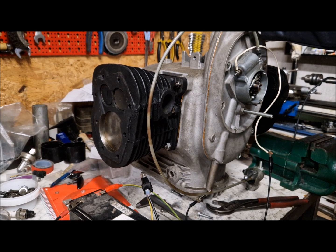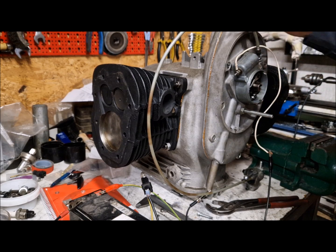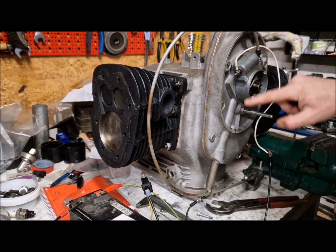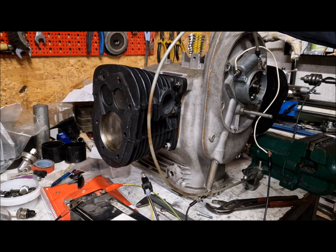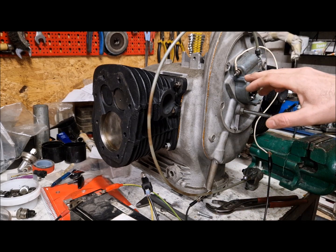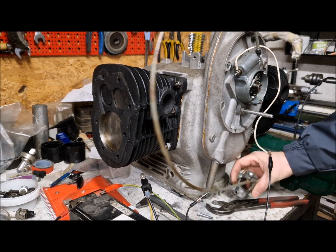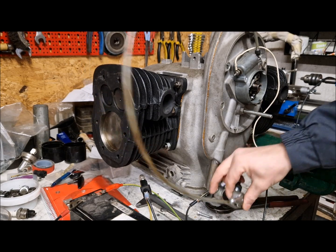Ideal is 8 or 9 mm, but for the moment I will leave it like this because it will work fine. In the future I am planning to build my own ignition — to remove this original ignition and make my own, maybe even an electronic one. The important thing is to understand this is the way to set up an ignition. You need a lamp connected to the points and battery, exactly like the ignition coil, and you need the retarder system — this lever and cable.